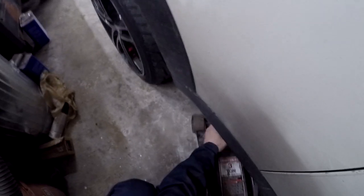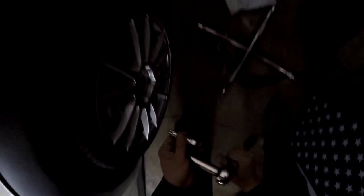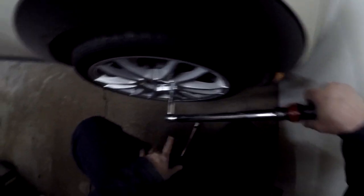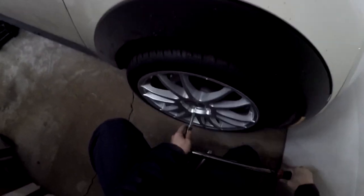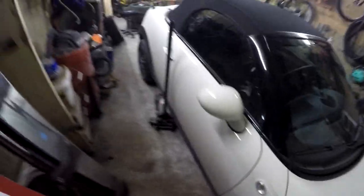Let's get under the next one. Now let's torque them. There are a few different types of torque wrenches — you have your beam type which can come with digital or analog, and you also have this click type. When you apply torque, science happens inside it, and you hear that click — that's the spring letting you know you hit the number. It works both ways, so if you need to go the other way, just flip the direction and the same graduation does its job. Torque wrenches can be pretty pricey — I have a bigger one in here as well. I like to use this smaller one more for this application.